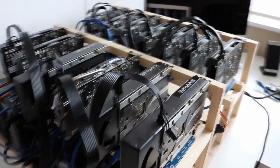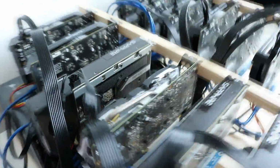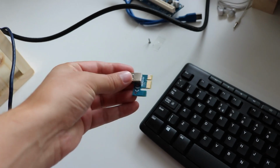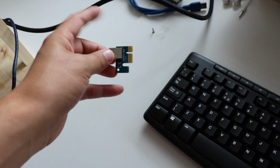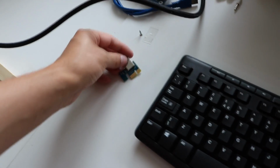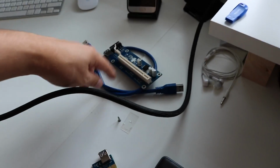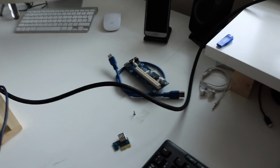I think I finally got it. So this card now is connected via a 1x16x ribbon cable, an old style ribbon cable. Probably might not have seen one of those before. Can't quite see in there. But the cause of the problems was this, the PCI Express connector end. So for some reason this one is not working. So it took a lot of fault finding to get to the bottom of it, but that's the problem. The cable and the riser seems to be fine.